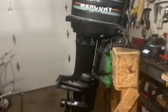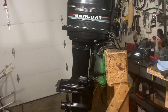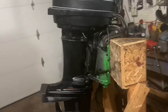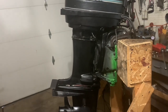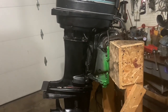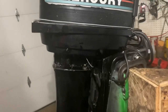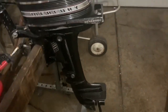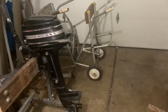YouTube, I'm back on the 45 horsepower Mercury with tilt trim, and I've still got the P-Stream coming out hot as you saw in the last video. I've done some research and found that these models were prone to having a water tube retainer up inside the power head that melts when it gets hot and restricts flow. I had the same problem with this little Mercury — this 069 — it had a nylon insert at the bottom of the base of the power head that seized up. Same thing.